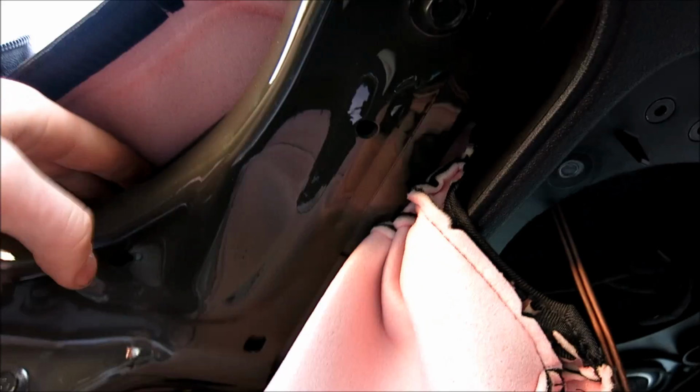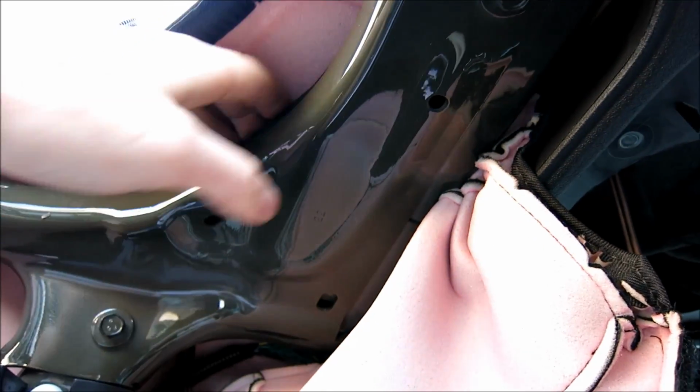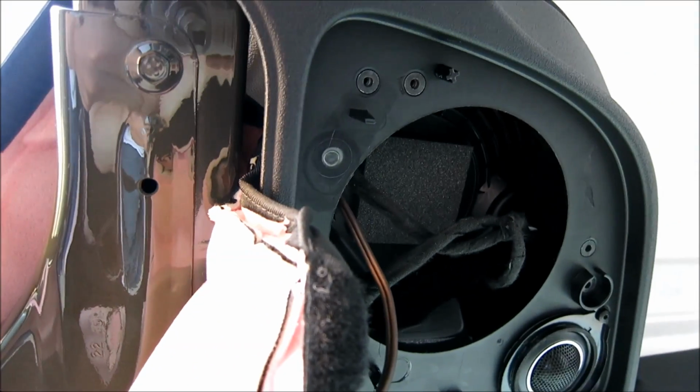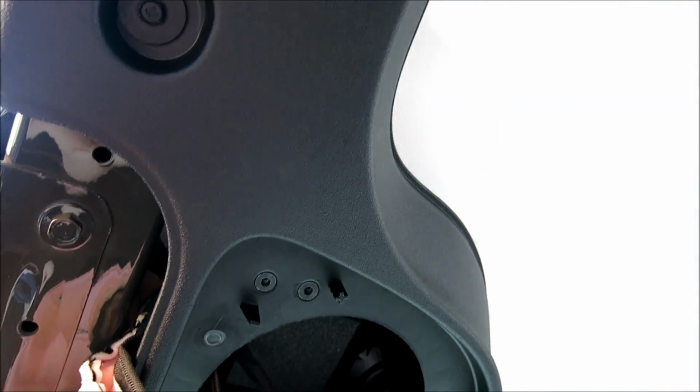And then now I've got them just coming down here, down through the A-pillar. If I tighten these up and tuck these in so I can zip them up, these will tuck in up there. Just like that. Get these nice and clean over here. And then they're following my other wires right here, just like I want it to. Right along here. So I'm just going to now put the other woofer in, and also I want to shoot some silicone in there to seal the hole, and then zap strap these up and follow it down.